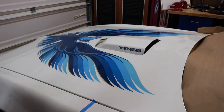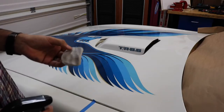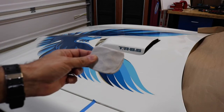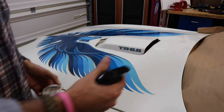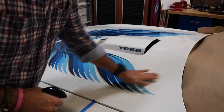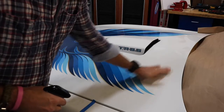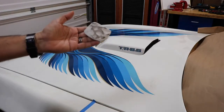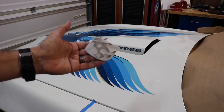No doubt there are plenty of you that are experienced that are screaming into your computer right now that I should be using a clay bar, but that could take several hours, even days to do this. So the first thing I want to show you is the surface of this clay here is actually fairly clean. Take a finisher product or a spray wax to create just a little lubricant. Spray it on there, rub the spot until it stops making noise. It does work. Look at the overspray it's taken off. Works out quite well, but since I've got it all over the car, I'm looking for maybe a slightly faster method.